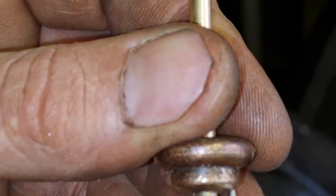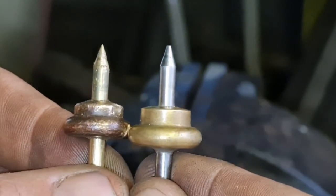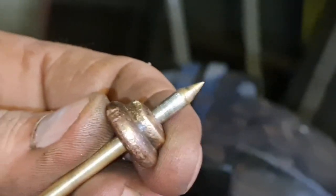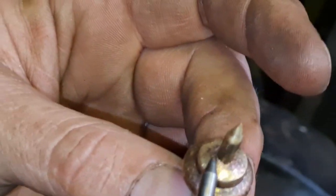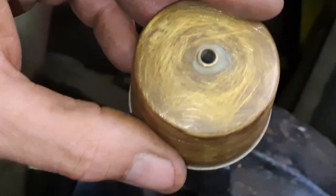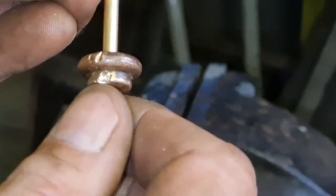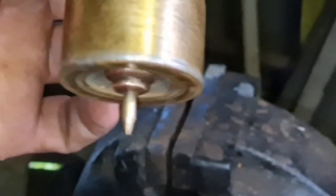Perfect! That is absolutely perfect. So we now have a good needle which we have made out of a bit of brass stock. I think it's 4mm - it was just a 30 centimetre length of brass stock which you get off eBay for about three pound fifty delivered. And it happened to be the right size to go through this pin, so we can make up a new one of these. And there you go, our float fits over our new needle we've made. So there we go, we've made a new needle up. Rustin horns fans everywhere will be impressed with the man cave solution.